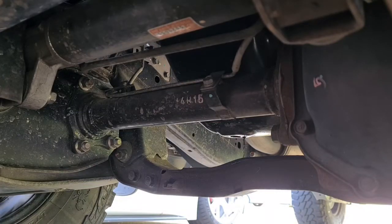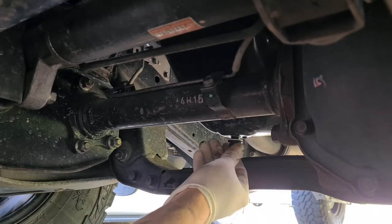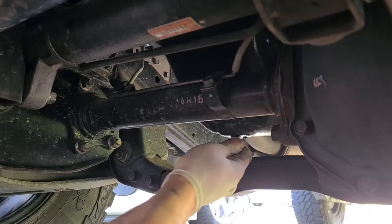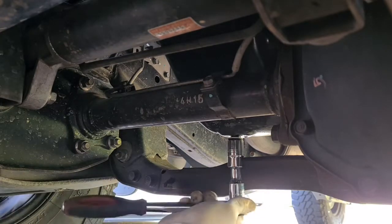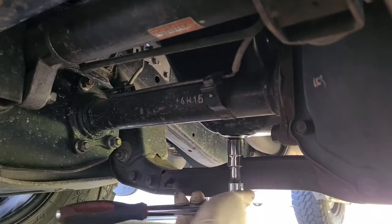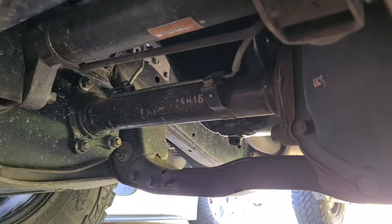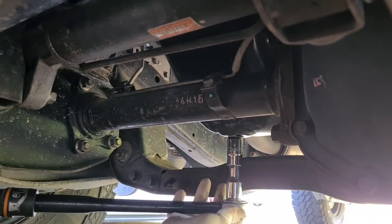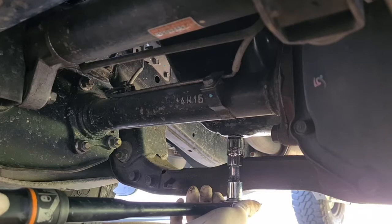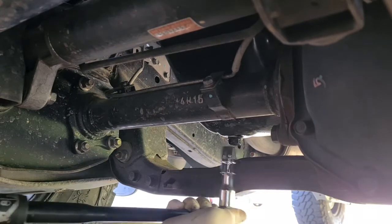All right, so let's get started. All we do now, put this in and screw it back in. Now that O-ring there expands as it comes into contact with oil, apparently. So we just screw that in. My ratchet. Tighten that up. And then I've got my torque wrench to torque it in. The torque spec that I'm torquing this to is just 39 Newton meters. So let's go. Oh, didn't click yet, bit more. There you go. Done. So 39 Newton meters on the torque wrench.